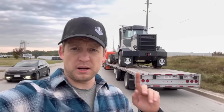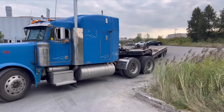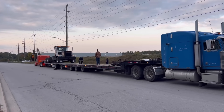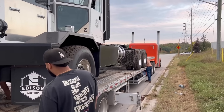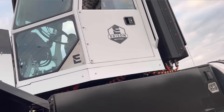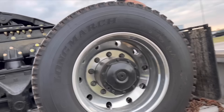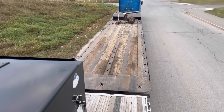Here's what to do if you need to unload a truck off a step deck but you don't have a loading ramp. First, you call your buddy Pepper to come over with his landoll trailer, then you back that landoll up to the step deck. The landoll trailer is pretty well the exact same height as the step deck. Once you drop the airbags in the step deck, you run around, take all the chains off, get her fired up — well, not technically fired up, it's an electric truck — you get the key in the on position and the air compressor going. Then you drive the truck onto the step deck.